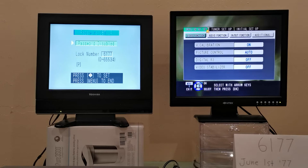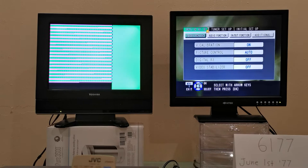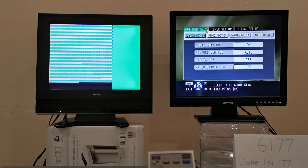Obviously Chris is a Bigfoot fan — that's why he designated this password. Alright, so that password has been set. Let me go ahead and get out of this menu setting on the master recorder, and let me go ahead and get out of the menu setting on the playback machine. Right now this master recorder is set up for the F1 channel, which is technically the front audio/video inputs. This has a small cover that opens up right there. Here we have S-video, we have composite video, and we also have RCA analog inputs.